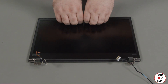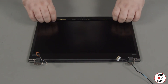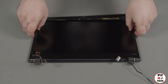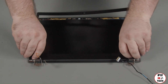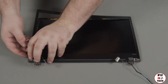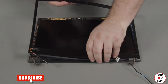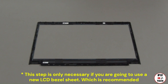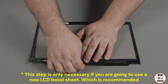Using your fingertips or a non-metallic pry tool, peel up the bezel sheet, loosening the clips along the edges of the LCD unit if necessary. You may also need to loosen the clips along the bottom of the LCD unit. Check the back of the LCD bezel sheet. Often the LCD bezel will remain stuck to the back of the sheet during removal. If the bezel is stuck to the back of the sheet, carefully peel it up from the adhesive.